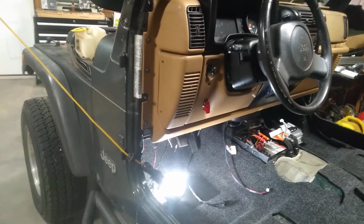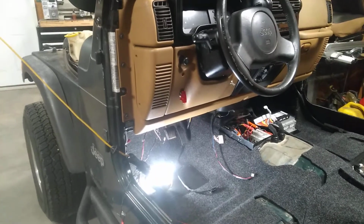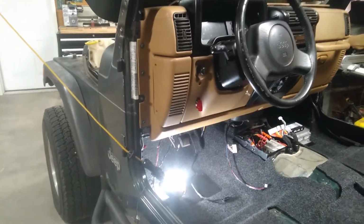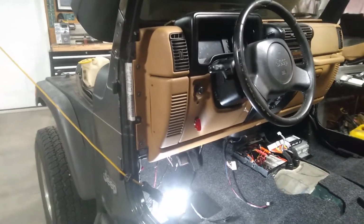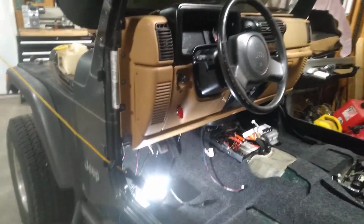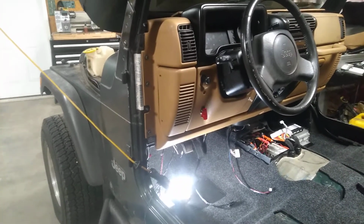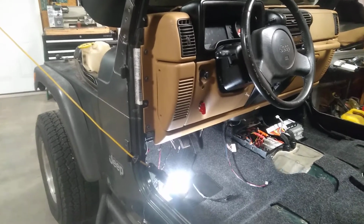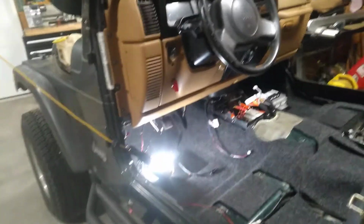So it's awkward. And if I'd have started out with this EV controls system, I'd have probably just started in the Jeep fuse block and rewired it there. But that's just not how it worked. So that's no problem. I just went on Amazon and they've got these little circuit boards with some little micro relays on them. Since there's going to be virtually no current going through these relays, you can just use little bitty ones, and I'll just tuck those away up underneath there somewhere. In fact, that's what all these are for. So that's pretty cool.